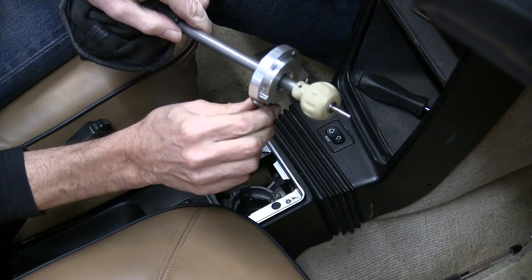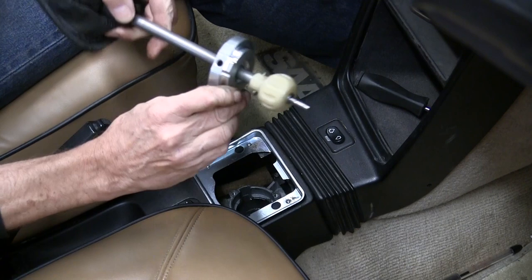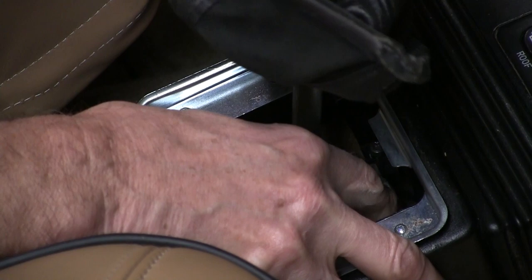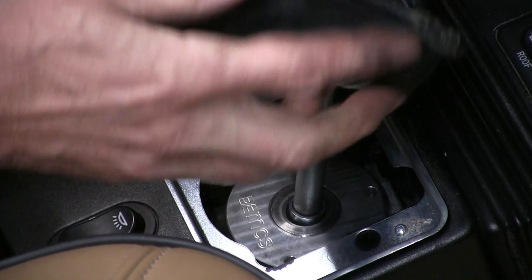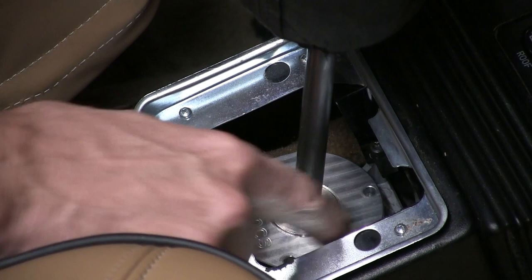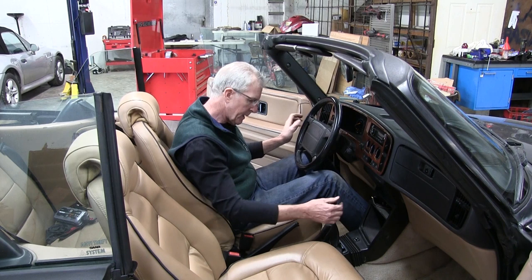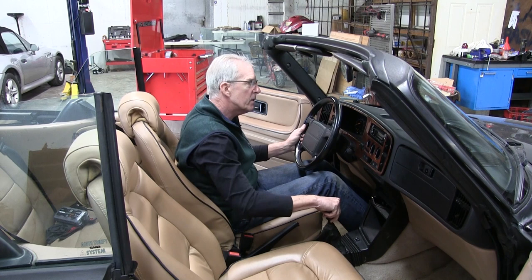You'll notice on the bottom of this piece of machined aluminum there is a little notch on one side next to an adjustment screw that lets you adjust your shift tension — how loose it is in the fitting. That little notch fits squarely into the housing on the shift assembly itself. I found you've got it lined up when the Modern Classic Saab logo is at the bottom facing you. Feel around and you can get that to fit right — the ball slides right in. Now your holes are lined up and we just screw things back in. It's all bolted back in — let's see how it feels. Oh yeah, so much more positive! You can feel exactly where all the gears are. It feels great. Here's reverse — a little squeak, maybe I need some lube in there, but the reverse lockout pin worked just fine.